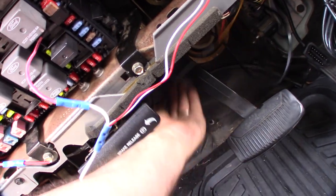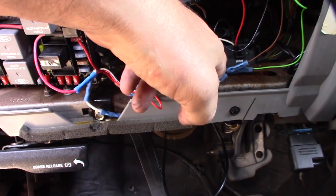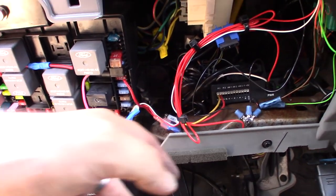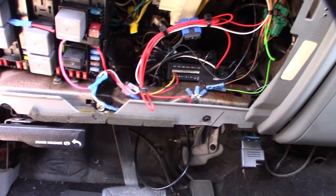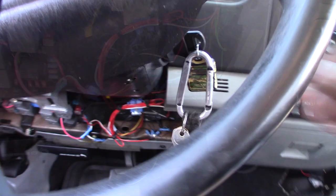The EGT wires are right there — all wired in. So there's the parameter and analog inputs, that's the thermistor right there, the five volts. The white one goes directly to the battery, black goes to ground, and positive is key switched. All right, put this back together and fire this thing up for the first boot.